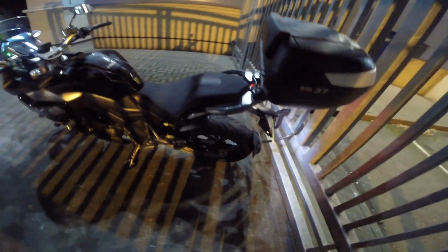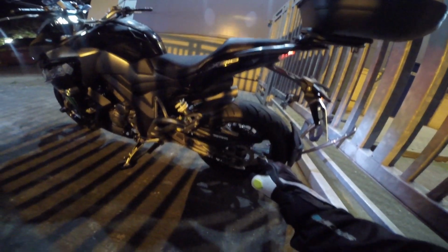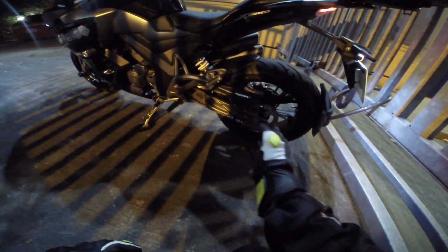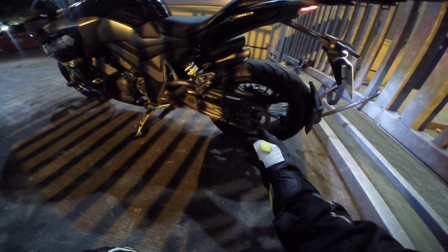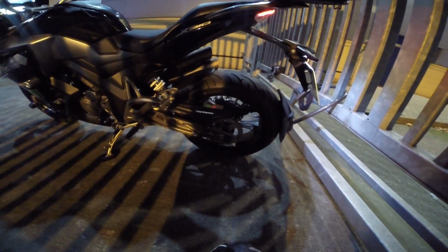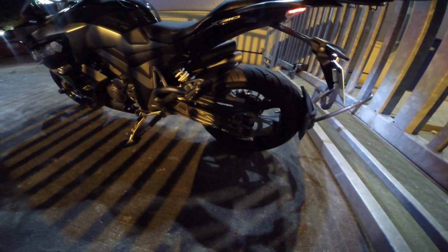And I did my back wheel, because I put the new chain on. I had a 42 tooth, I put a 40 tooth rear sprocket on with a new chain, so I could bring it forward, because I'd take a couple of links out of the chain to bring it forward, because obviously it's a slightly smaller sprocket than the 42 tooth. But yeah, it's brought it forward again now, so the wheelbase is narrow again, so it's tight on turning, and I got some play then for when the chain slackens off a bit, I can pull it back.